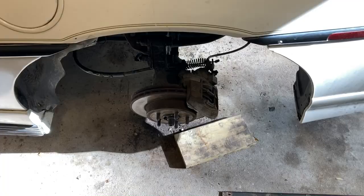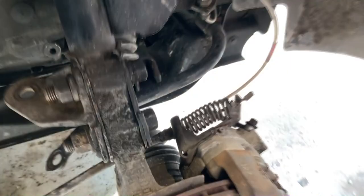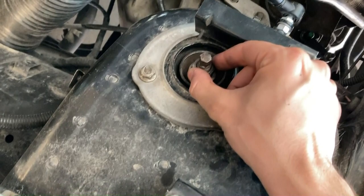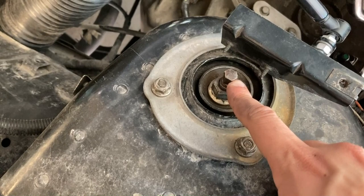Since I was already doing bushings, I figured doing engine mounts would be a great idea — and why not get struts too. I installed new bump stops and boots in my struts. You've got to get a spring compressor to compress it down, and once you take the three nuts off it will drop out after disconnecting the bolts. Once it drops out, grab the top with vice grips and use a big wrench — maybe a 21mm — to get the nut off. On my Monroe struts the stud is between 10 and 11 millimeters and not English either, so nothing worked great and you just have to use vice grips to get it off.